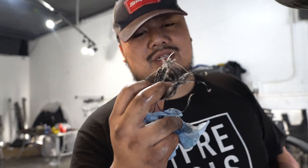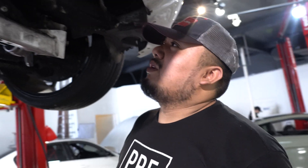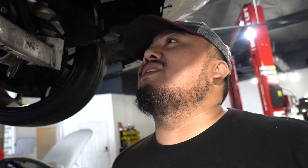We now have full access to everything down here, inspecting basically every cylinder and removing any additional belt left inside the car. We removed the pump because we're changing it out, and then we're going to inspect all the timing guides — but honestly I can already see the timing guide has been damaged, so we need to replace that too. If not, it's just going to fail eventually. Hot tanking the motor is still a big recommendation. Even after I pulled it out and removed all the hairs I could find, all these little galleys that pull oil to passages in your motor were filled with hair.